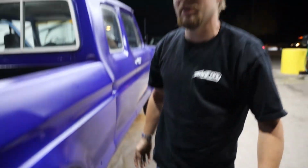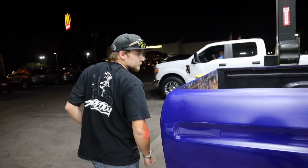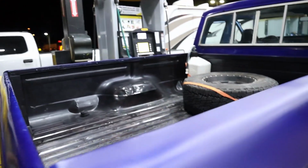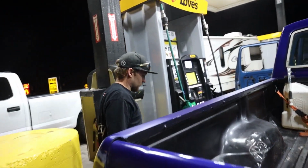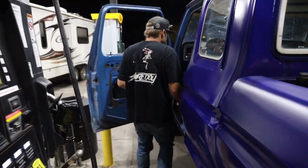Parking brake, engage. Yeah, I see what they're talking about. Every time you let off throttle, there's a little poof of smoke. I think what's happening is whatever's dripping off the transmission is hitting the mufflers. Yeah, and it's just burning it. Exactly. But how's it driving? Still pretty good? Solid. Nothing really different from when I was in it? Nope. Sweet.